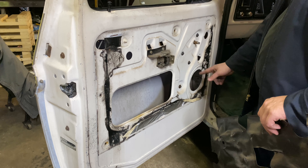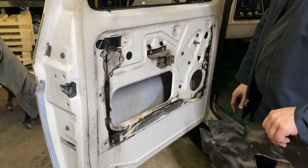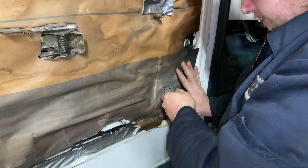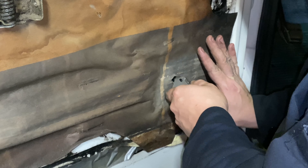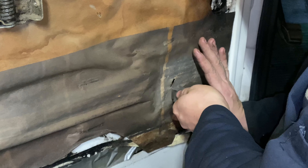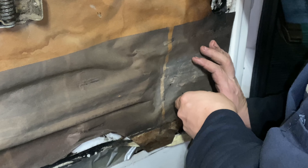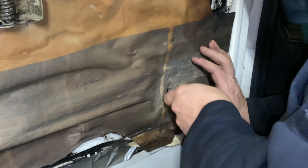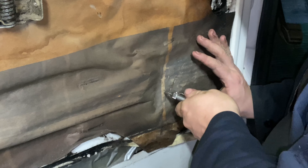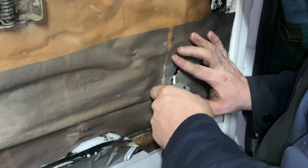After you do that we can pull this off and get ready to start assembling our speaker setup. Now this water shield is not in the best of shape, but what I'm going to do is take my razor blade and put it in here and cut it until I hit the edge of the hole. There's one — there's another — and just do an X pattern. Then we kind of got to cut out where it's going to be.